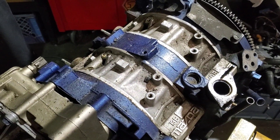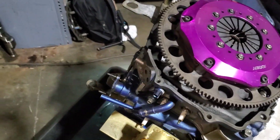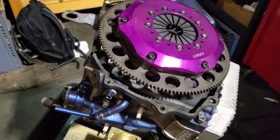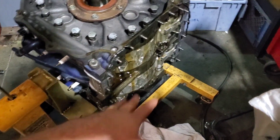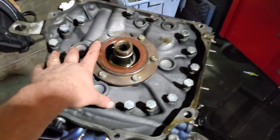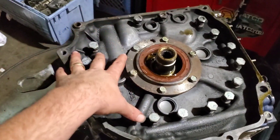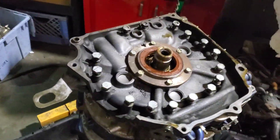Mazda RX8 half bridge. We're going to start with removing the flywheel, the front pulley setup, oil pan, and water pump housing — basically going to strip the block down. We stripped off our oil pan, pickup tube, front cover, oil pump, and most of the front oil pump drive and counterweight assembly. Flopped the block over, loosened up all the tension bolts, and now we're going to pull our tension bolts, take the rear iron off, and actually see what's going on inside this cool little Renesis.